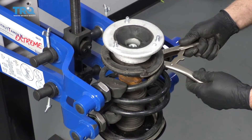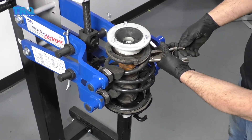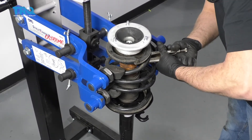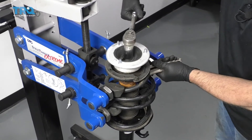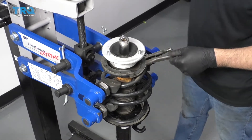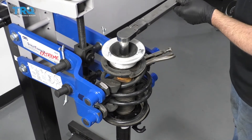I'm going to do the same thing with the locking pliers — just make sure they're up high so they never touch the seal at the base of the strut. Now I'm going to tighten this up by hand, and once it's snug, I'm going to torque it to 47 foot-pounds.